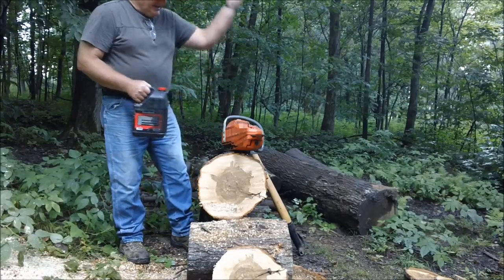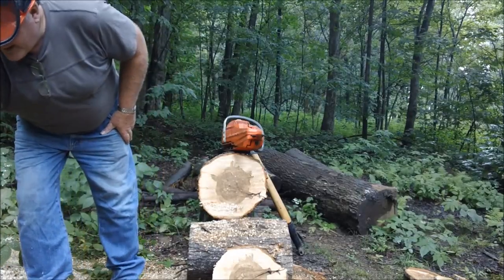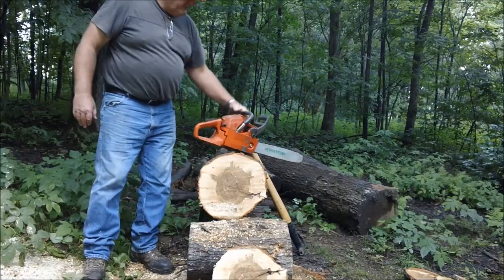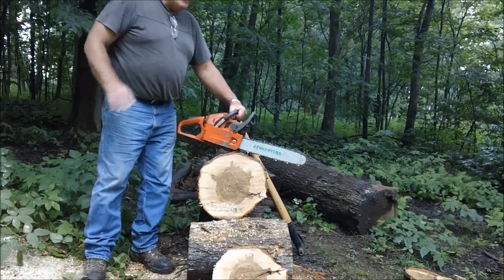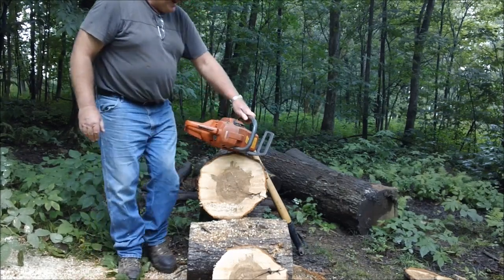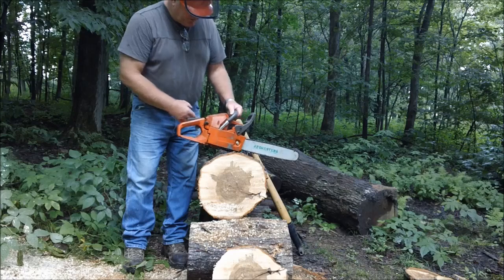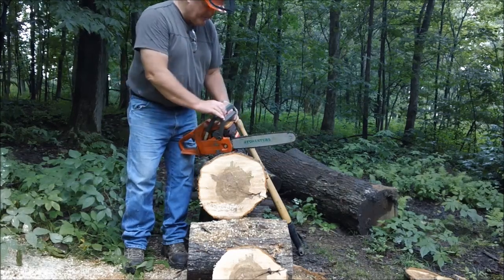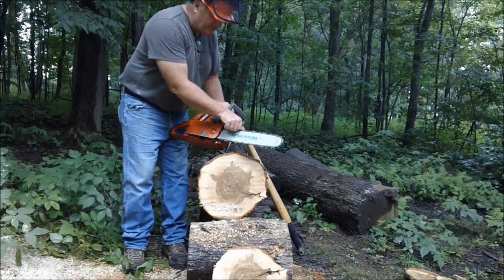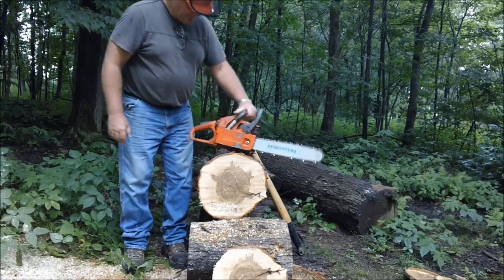But this is a guy, you know, the simulation, the video, this is a guy, what does he know? He heard Husqvarna's a good brand, found one for cheap, bought it, and now he wants to know what he's got. The other things you gotta look for if you're gonna buy a saw, you wanna make sure it's complete. You wanna make sure that all the covers are there, they're not broken or cracked up. Throttle works, choke is working, switches work, nothing's bent, chain brake works. You know, you want to have a bar and chain that's serviceable. This one happens to be, it's got a cheap bar, but that will work.